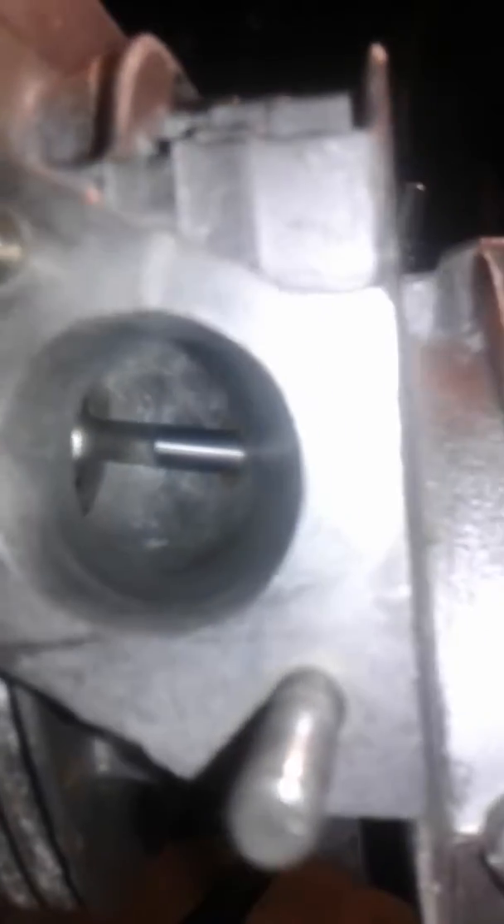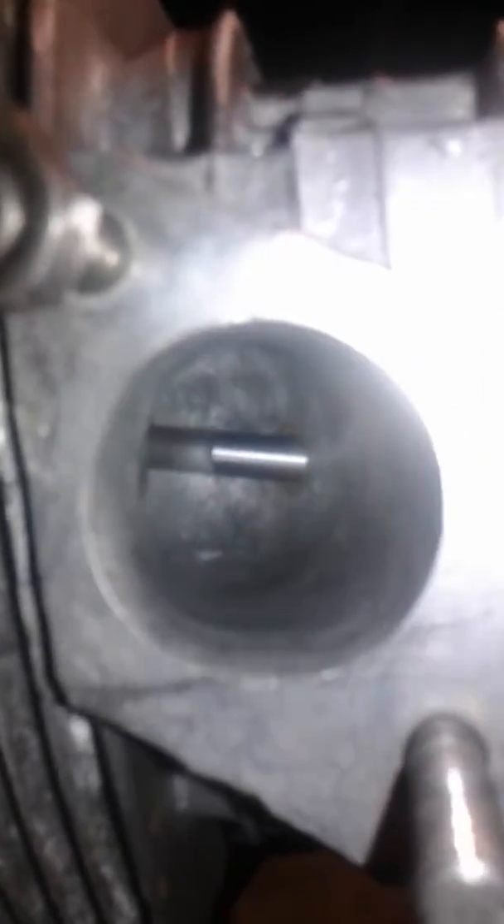This engine has a lot of work in it. That's the exhaust side — it's a little bit bigger. I didn't go crazy, but I removed the guide to get a little more flow. They say it's not good to remove all the guide, but it's too late now — hopefully it'll get some power. I incorporated whatever I did to my 1776 into this one. Here's the intake side.